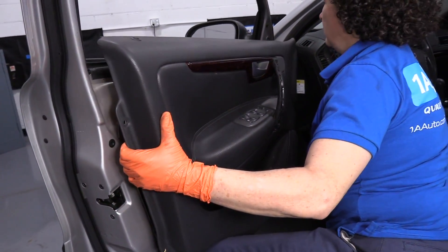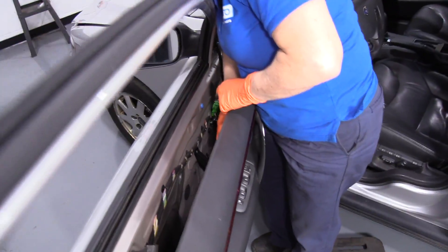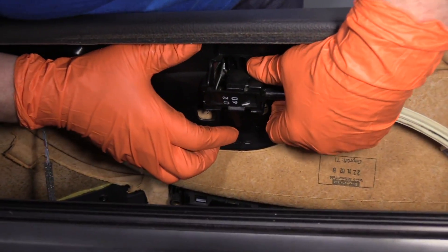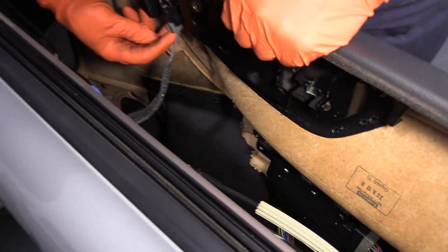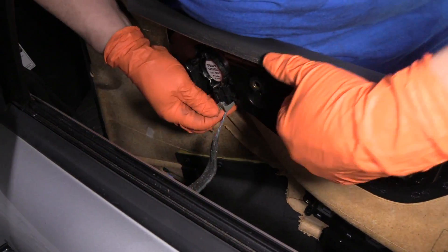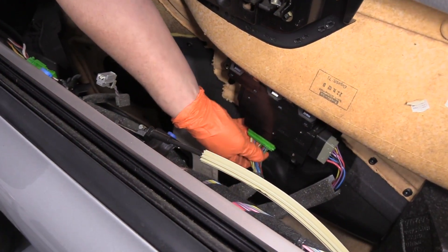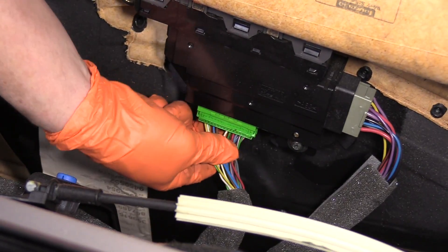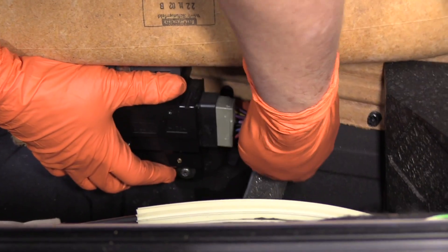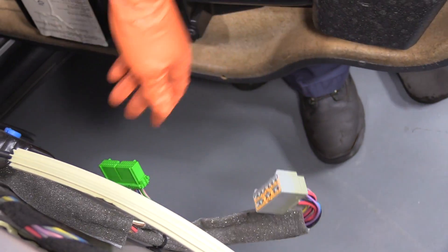Grab the panel and pull up. Once it's pulled up, you'll see the door panel. This is the cable for the inner handle — just grab it and pull it off. It's a real nice design. Then we have a little mini tweeter speaker, and we'll just take that clip out, push down on it. Then the clip is on the back side of this main switch on this green — pull it down. The same with this gray — pull it out. Then you can see the clips, those are the push pins on the back, the push clips.